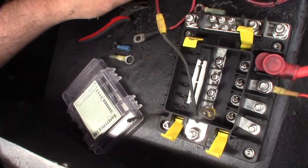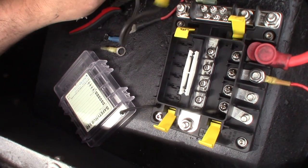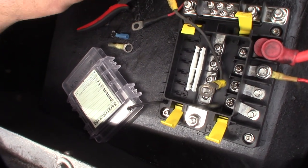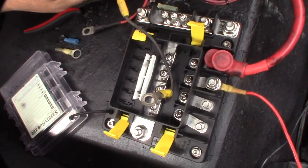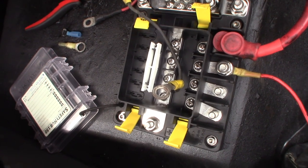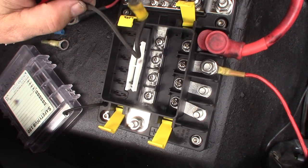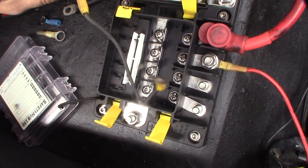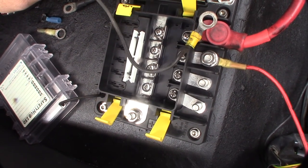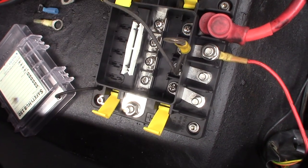About 15 years ago, before I was doing YouTube, I rewired this Bronco's whole electrical system — lights, everything — using a Bronco-specific wiring kit. It originally came with a fusible link, which is basically a fuse that melts the wire at a certain amperage — they're horrible. I'm replacing that and putting it right into the fuse block since I have enough slack.